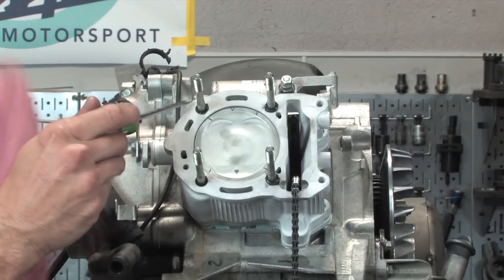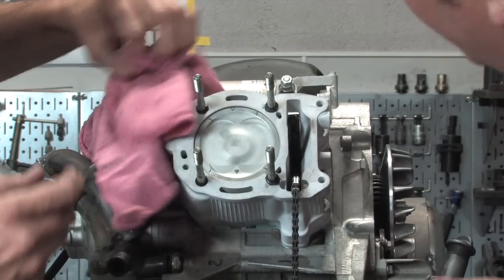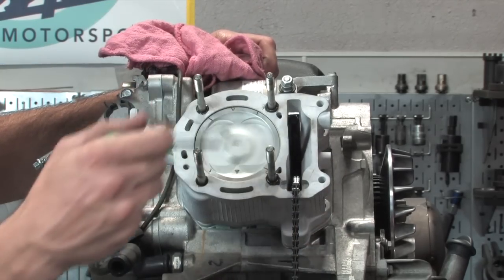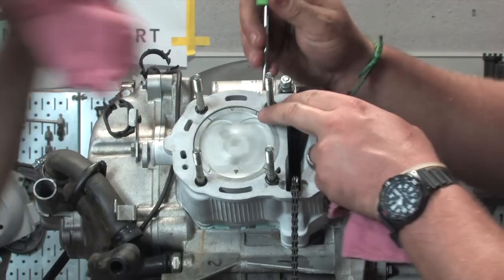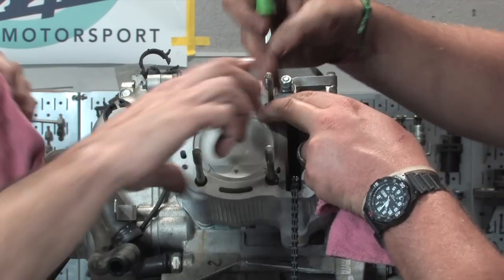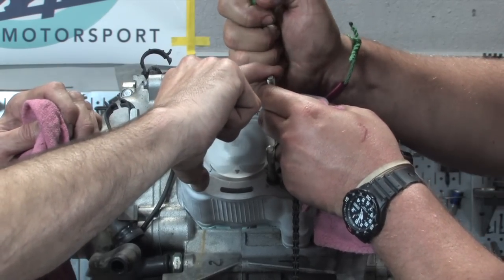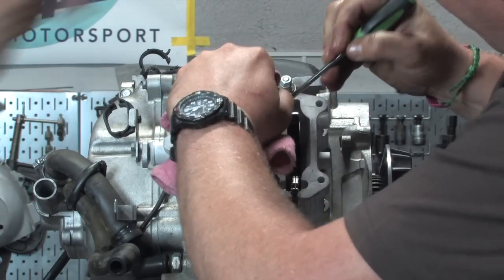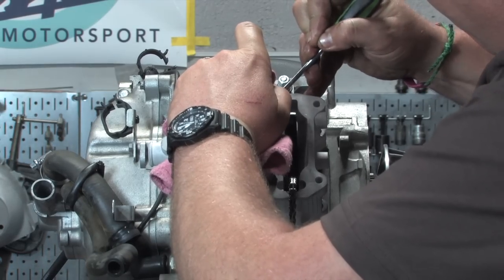So you can see this O-ring is not as seated as deep. Oh yeah, I can see that. I don't know if the camera can see that. This one's going to be deep because the dowel's going to go in next. And these ones look practically flush. And again, one of the key tips, see how I steered, he's pressing it. I'm pushing the stud 180 degrees away from wherever we're doing the O-ring. It helps it drop into the well a lot easier.